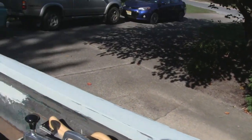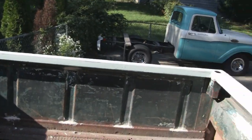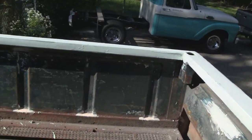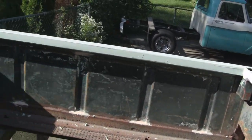All right, be careful. All right, we sanded everything down, put one coat down, then came back and filled in the low spots. And now what's going on is, I started with 36 grit, went down to 80 grit. And after 80 grit, a lot of guys just keep it at 80 and then spray 3, 4, 5 coats of polyester filler on it, you know, and then sand it out.